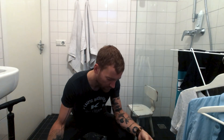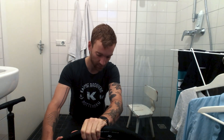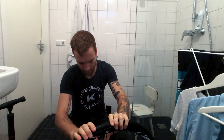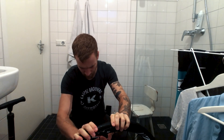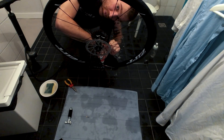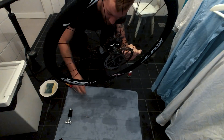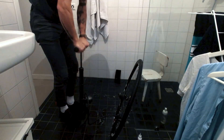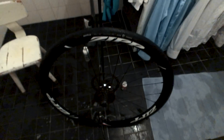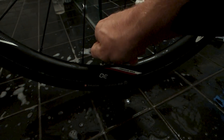Now it has air in it, but I want to add the tubeless sealant, so I think I have to deflate it again. How much are you supposed to put in? It's empty so everything is in there. I'll pop the valve back in. 60 PSI — there we go. There's some goo on it but I think that's just from installation. That worked! I'll do the other one and see you out on the bike in 20 minutes.